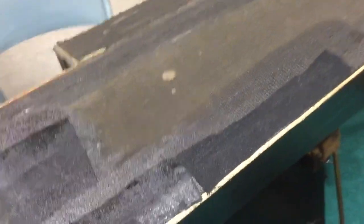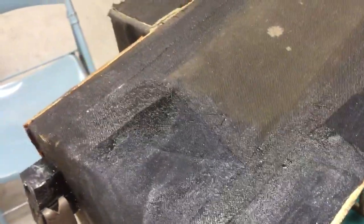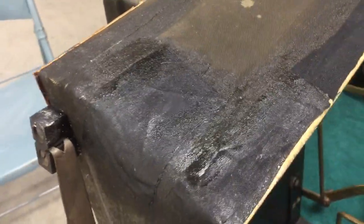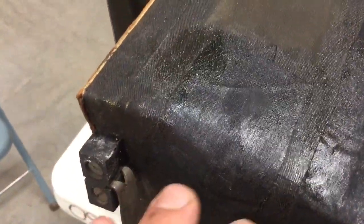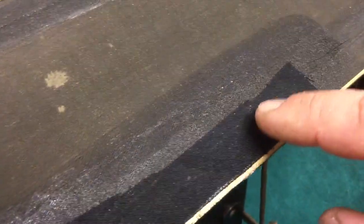I got the idea from Steve's Piano Repair website, and he gave instructions about using rubber cement and cotton cloth to repair the bellows. The corners of these bellows had some tears in them, and I noticed that the outer layer of cotton in places along these edges where it folds has got some places where it's coming apart.